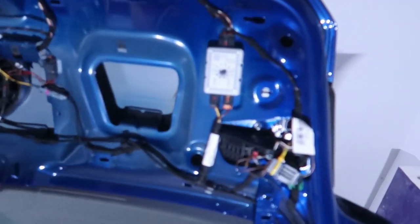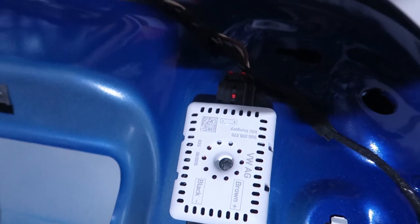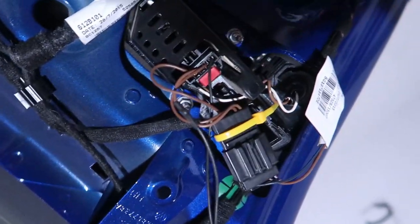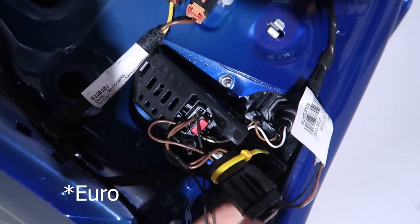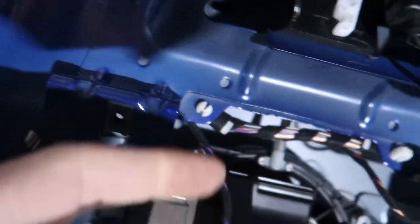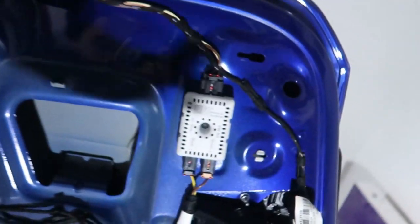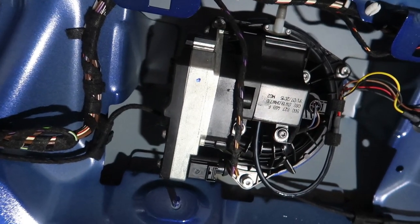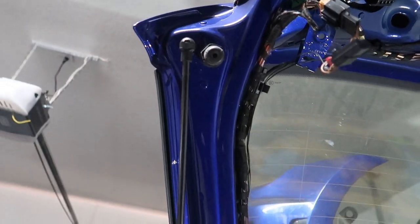Here's the hatch - got all types of stuff going on. I think this is a video encoder; there's also some impact module - let me know. I had to run wires for these facelift lights, same thing on this side. It looks like there's a clip every almost inch holding this trim down, so hopefully I don't break too many getting these out. I've got tape and a marker to label everything. Only thing we really have to remove is the tail lights, the camera, and the latch. The seal is on the car, not on the hatch - I didn't realize that, which is awesome.